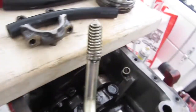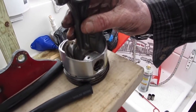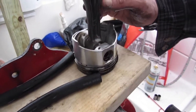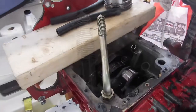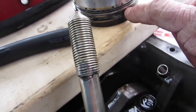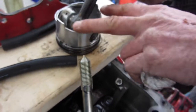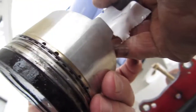There it is — number one. Now we're going to take this piston out exactly as it came. So this guy's going to come up and we're going to set him back exactly the way he was. When you clean this, take the Babbitt bearing out — it's very thin material, coated. We got cylinder number one out. Note that number one had good compression and all the rings are moving — they're all free. There are no cracks in the cylinder. You've got one oil ring and two compression rings. We're going to mark this with some tape so we know exactly which way it goes. The arrow means exhaust — there's a little arrow right here on the piston, and that's on the front. The thing looks in perfect condition.